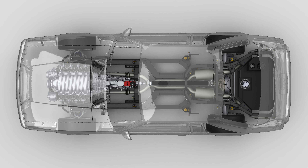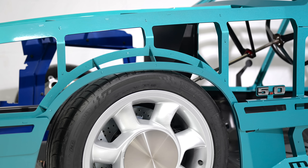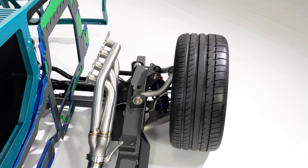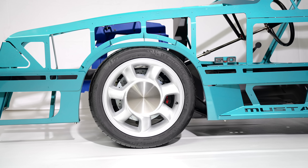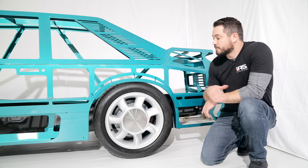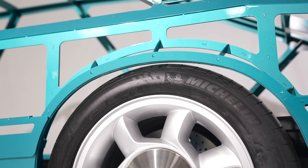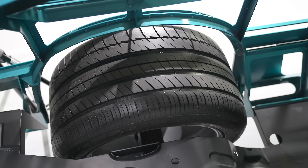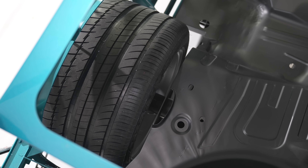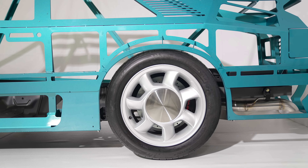The way we've designed this chassis and the ideal ride stance has allowed us to drop the fender lip and fender line about two inches, closing that gap you'd normally see on a stock fox body that hasn't been lowered. This allows us to run a 255 tire — the max recommendation — and on this one we're running a 255/40/17, which is about the max recommended tire size that still allows full lock-to-lock without any issues. In the rear wheel well we've dropped that stance as well, closing roughly two inches of gap above the tire. A 285 is the max tire in a factory wheel well, but on this chassis, if you install a mini-tub kit you can run up to a 345 tire. Right here we're running a 335/35/17 with the fan blade wheel.